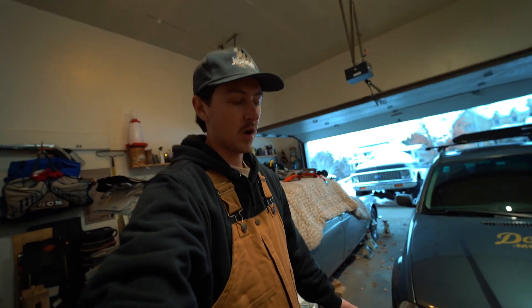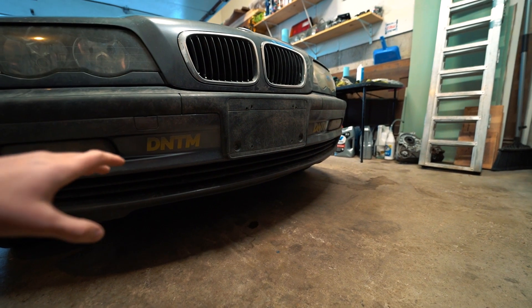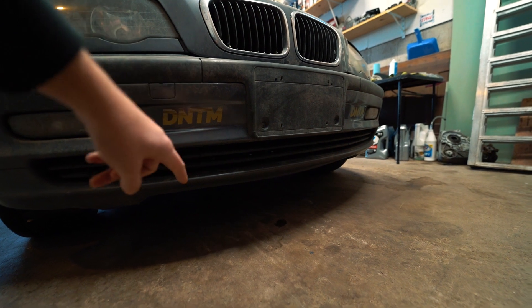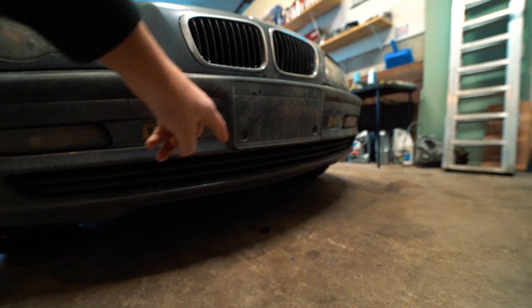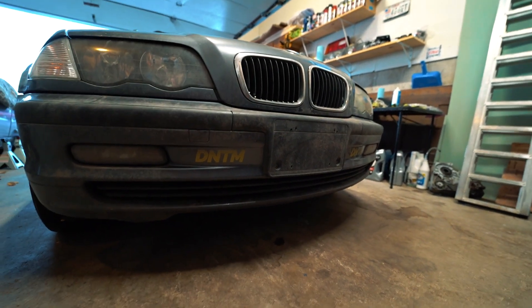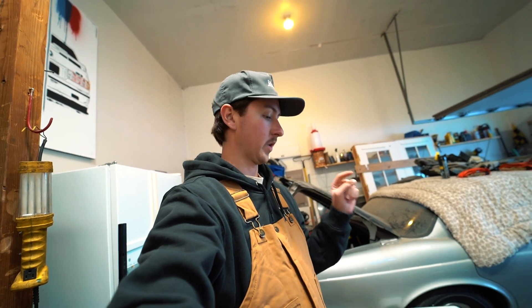Now that we've got the wagon in the garage, here's the game plan. The base model E46 has a nice lower grille, so I'll take the bumper off, cut out some of these center fins to fit the light bar in, and then wire it right up to the fog lights so it can be turned on with just the fog light button. If you want a tutorial on removing your E46 front bumper I'll link it in the corner and in the description — I've got a detailed tutorial on that.